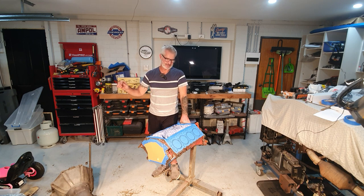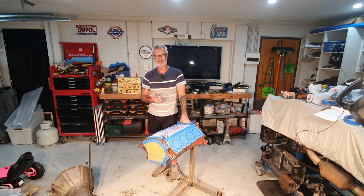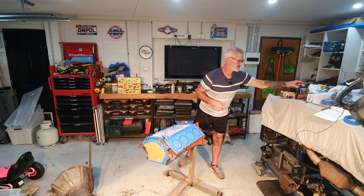And I cleaned it, and I ran a pipe cleaner type thing through the oil galleys and stuff to make sure everything was clean, and I washed it all again. Water blasted inside, water gurneyed inside all the water jackets, drilled them all out so they're nice and clean, washed it back out again. I just degreased it and prepped it again tonight with a bit of Prepsol type stuff.